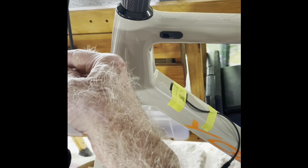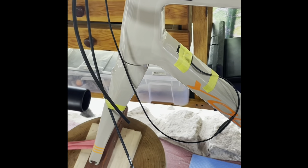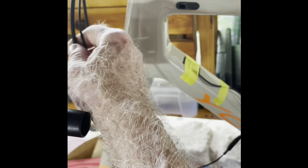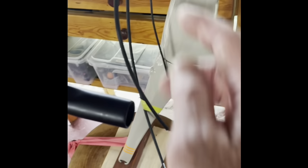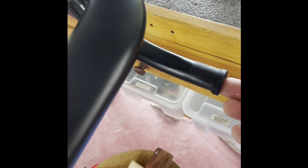When I bought all the DI2 stuff from Art at CYC here in Rayon, I bought a Y-splitter. I'd never done DI2 before and he said I'd need one. But when I decided I'm going to put the D-fly unit in the handlebar right here, I needed a way to get power to it — I did that by running a dedicated line from the left shifter through the handlebars down into the D-fly, and then junction A went in there.